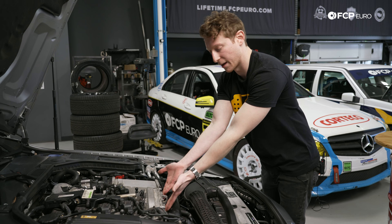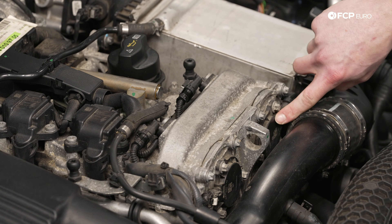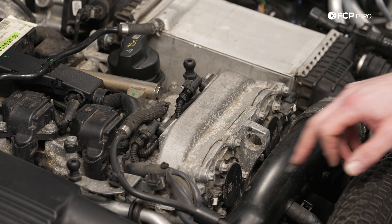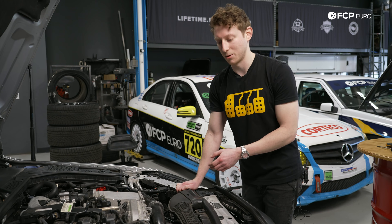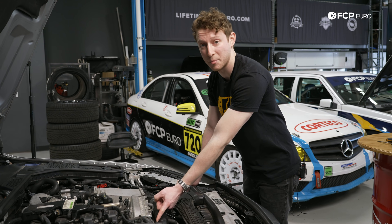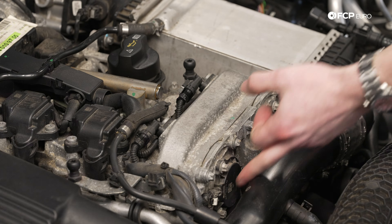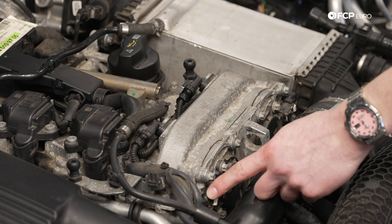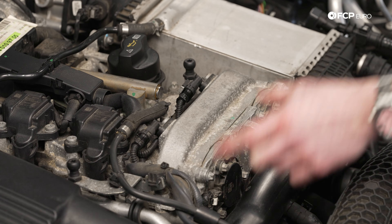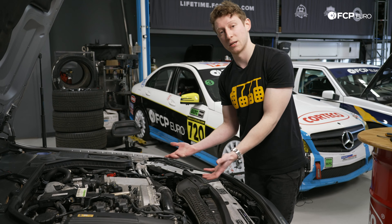All the way up at the front we have these two black, almost triangular sensors — these are going to be your camshaft magnets, one of those common oil-wicking failure points. They're super easy to get out: it's just going to be three E12 bolts. You may have to move some things around in front, but once you get in there it's not too bad. Honestly, with any of these engines, the hardest part of this job is going to be getting these little electronic connectors unplugged — they can be a pain. You're probably going to want a hook pick, but get those guys unplugged, pull the old sensor out, put the new one in, and when you plug the harness back in at the electrical connector, you add in those sacrificial pigtails that we include in the kit.